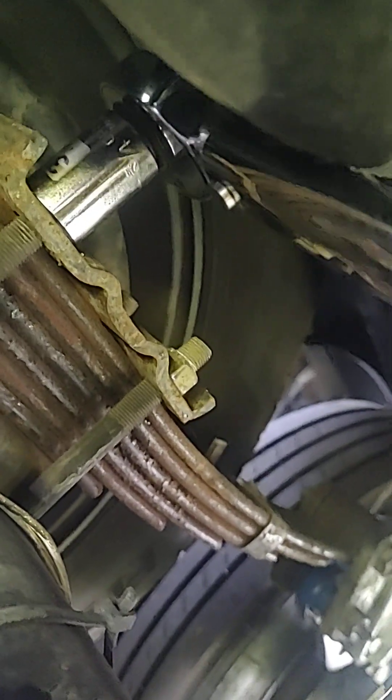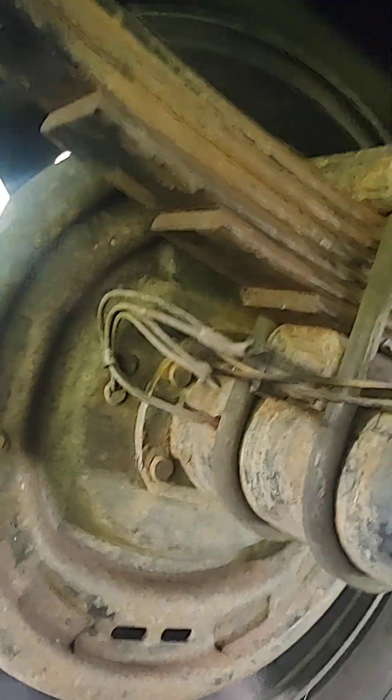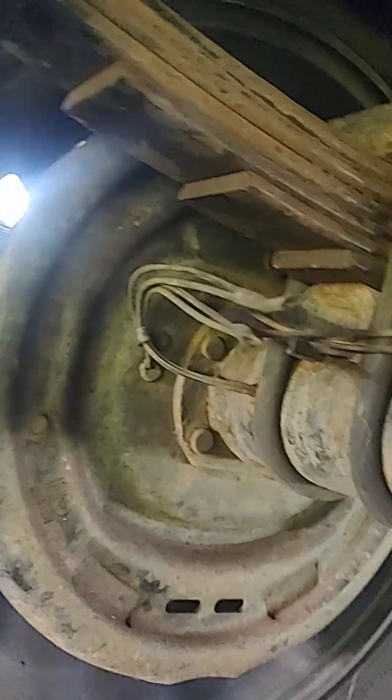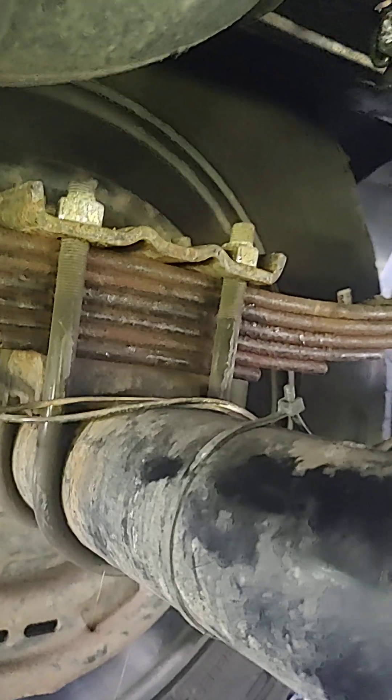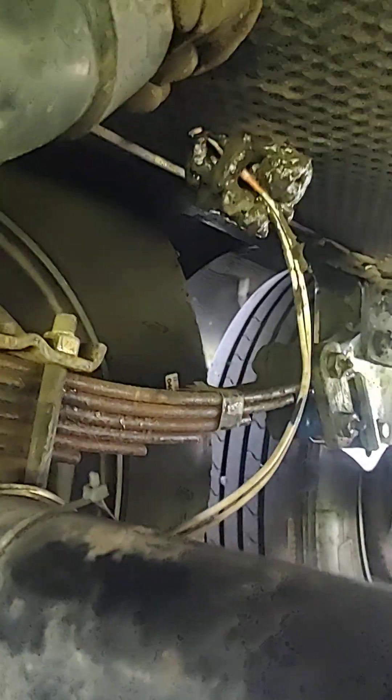You go back and forth on them if you get a lot of turns. I'm going to go through all my springs and carry on. It's kind of crazy — did they torque them the way they were supposed to when they replaced these springs? I don't know. Did they come loose after being flexed down the road? I don't know. Anyways, I'll get that torque wrench on there and do the other two nuts on this U-bolt, then go to the forward axles and do the same thing.